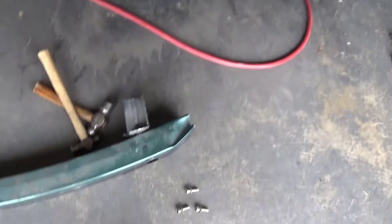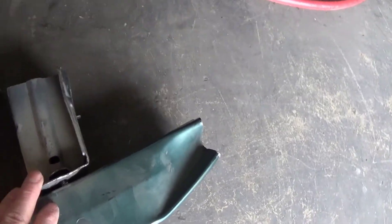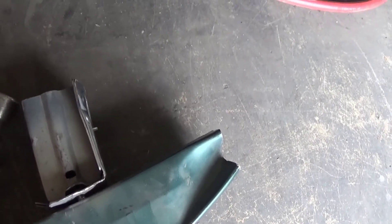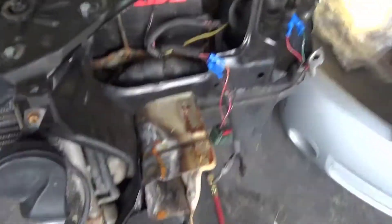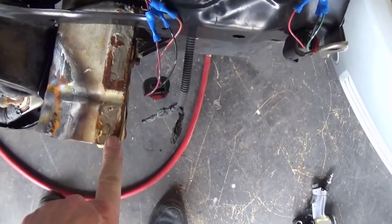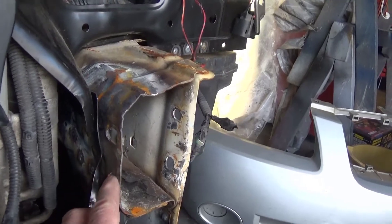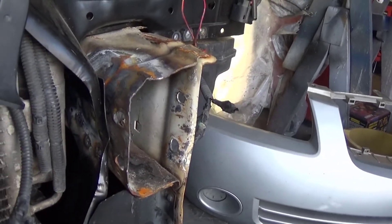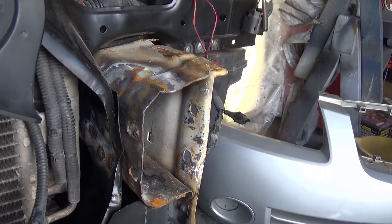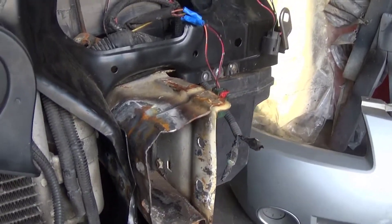They had everything together, had the bumper on and everything, but this bumper support was actually pulled and ripped right here. The upper stud that goes into this half is broken and no one has one, so it's going to take a few days. What I'm going to do is just tack weld it. The problem we have here is this frame rail is ever so slightly off — this part's correct on this end but it goes back at an angle, making the holes right here a little too far back. So I'm going to slot them, cut this out, then take a washer once everything's bolted in place and tack it onto the frame so it still adds strength and everything's bolted back the way it should be.